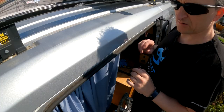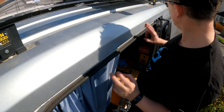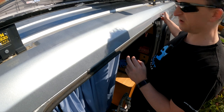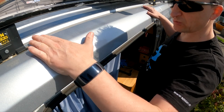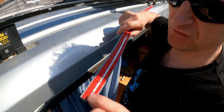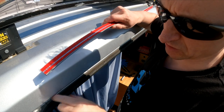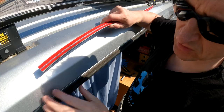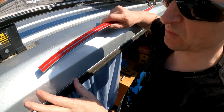Now we're going to mount it inside of the van and I'll just cut off the excess that I don't need. Let's go and put it on the van. The place where we're going to fit it is along this edge here — there's a little seam here and a little seam just back here, just over the top, so it catches the water that comes off this edge. On the back of the guttering you can see there is an adhesive strip — it's just a case of peeling it off and sticking it to the van. We're going to follow the contour line just above the door so it sits just over the seam, which enables us to follow a true line on the van as well.